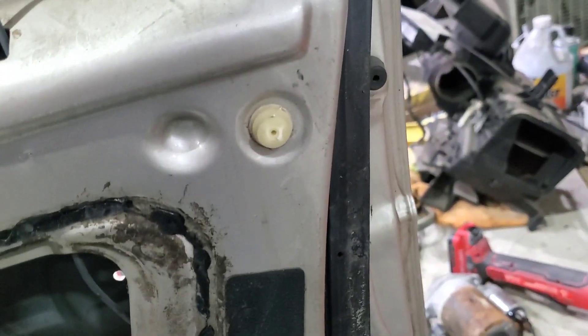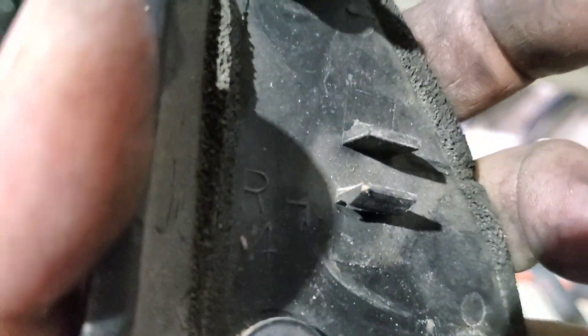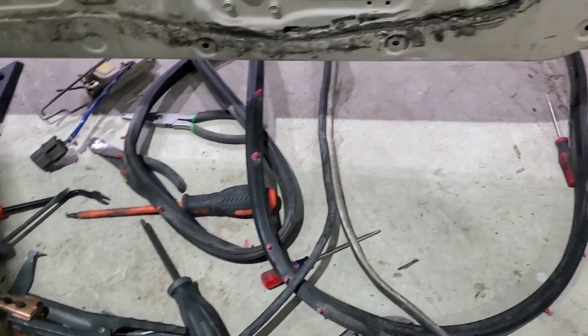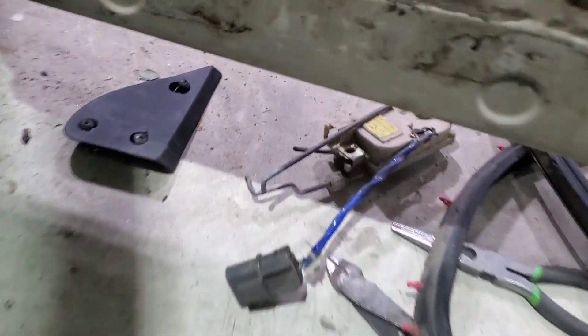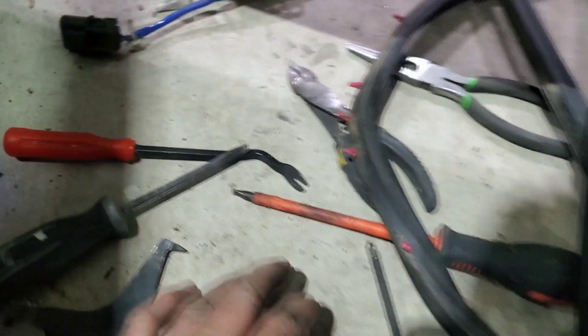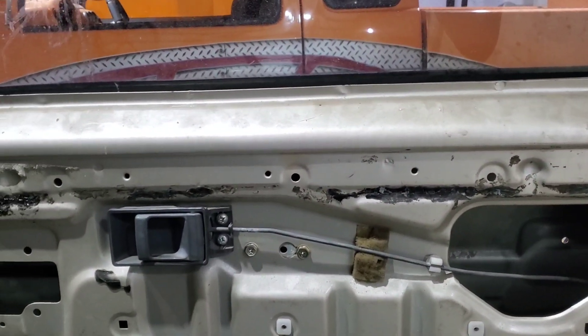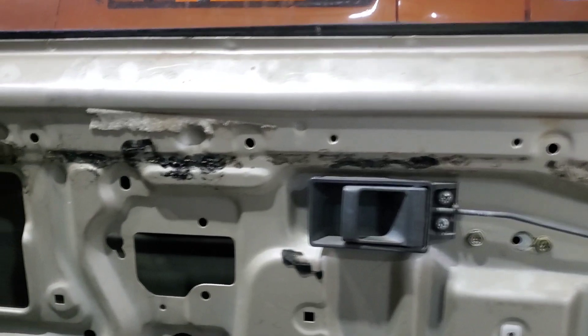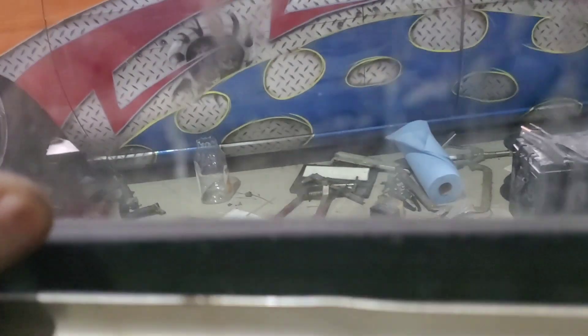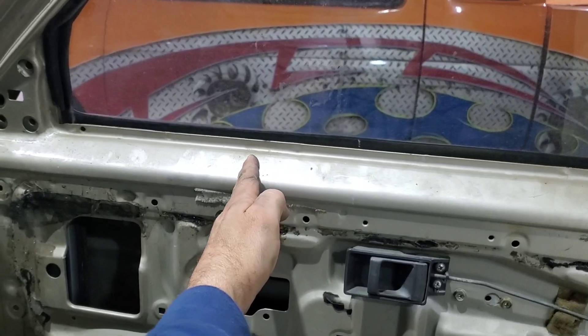I got my mirror and this black piece — once you get the screws out it's held in just by that little tab, so it just pops off. I am going to label all of this 'right front door' and tape all of this up so I save all the pieces to go back to this door — paint it and then reassemble fairly easy. What I need to do now is get this window down partway because there is a bolt that holds this window in roughly here and here.